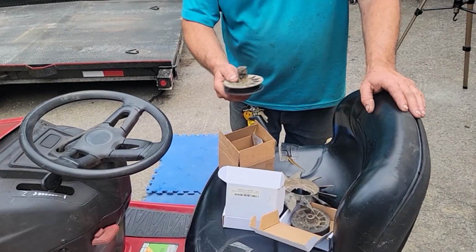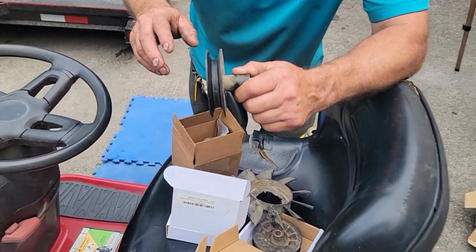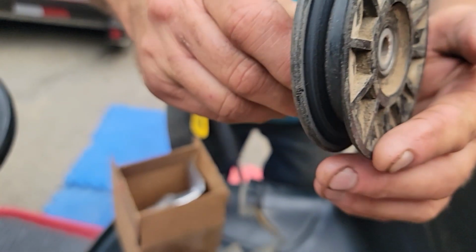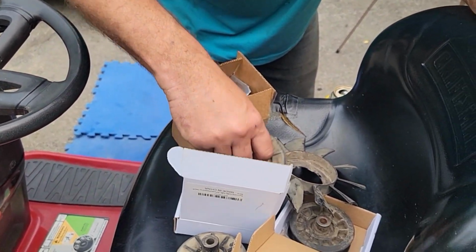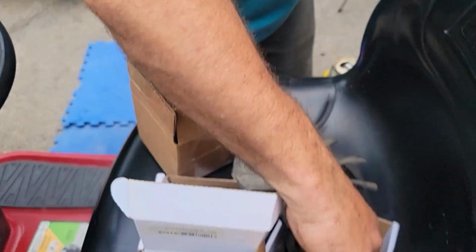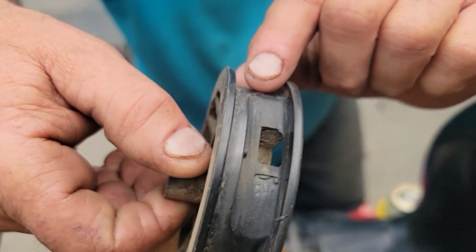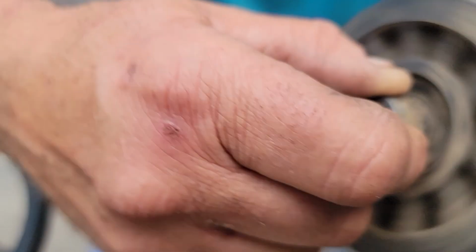All right, this is the last pulley that we've been waiting for. And come up close here, you can listen to this. If I do it right. Get my arm off this. Can you hear that? Now, that echoes, vibrates through the... That one don't make much noise. The front idler, the flat one that burnt a hole in it. Hear how dry that is?